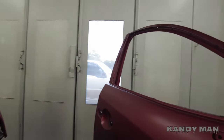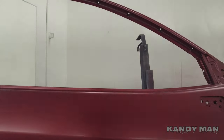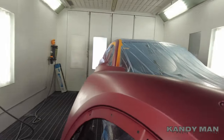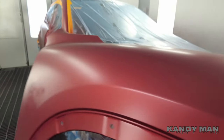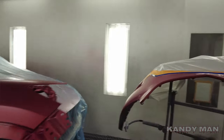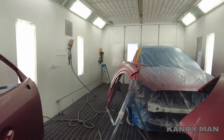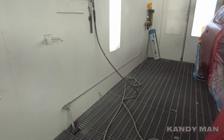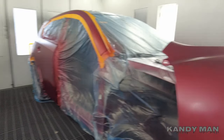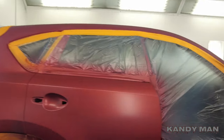I'm going to blow on it a little bit with a handheld blower. We're going to be putting the Becca system in the corners of this one next, because this is an older booth — it doesn't have the air movement or the two-speed motors in it. I made a call and they're going to be putting in the Becca stuff soon, so that'll speed up the dry times. I had the Becca one in the old booth — check out the old videos if you're new to the channel. This booth only cranks up to about 90 degrees to spray heat, and that's plenty of heat if you've got the blowers, but without the blowers there's not enough air movement. With the blowers in it, I'll be able to get out of the booth faster, get through cycle times faster, and paint more cars. Stay tuned as I put the second coat on.